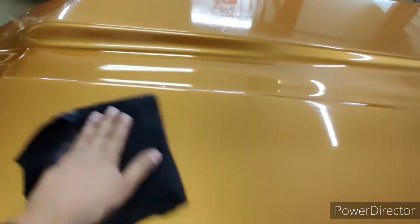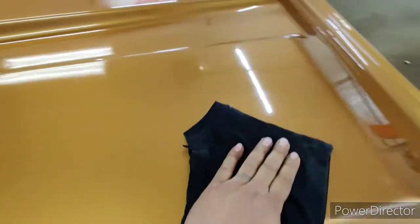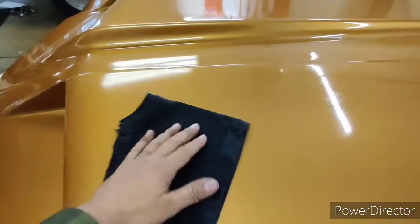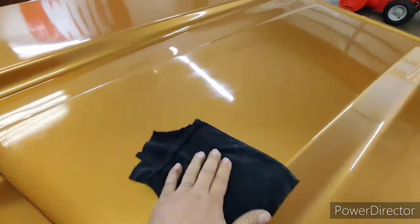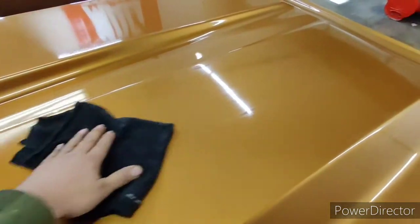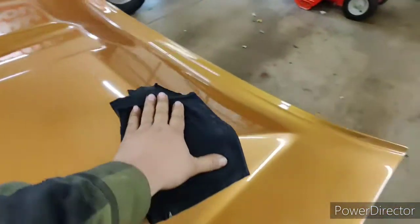So, making sure it all comes off. I'm going to clean it off before I even scuff it. This is important. Otherwise, when you scuff it, you end up pushing all those impurities, oils, or anything further into the finish, into the grit, into the bite, and you might run into issues. So this is why it's very important to clean the surface before you even do anything.